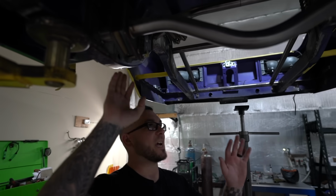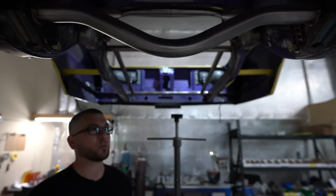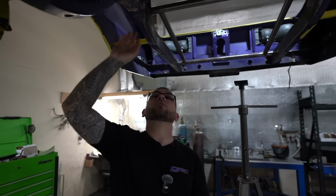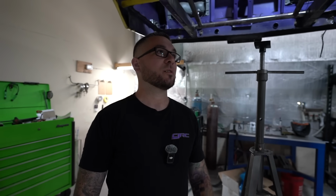We can pretty much cut this tack and raise it up now to get our ride height a little bit lower. And we may have to notch this frame rail. So definitely some differences from the small engine and the ride height we were going to have to the plan now, which this is the time to do it.